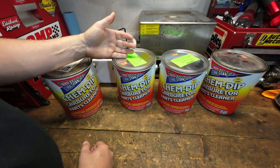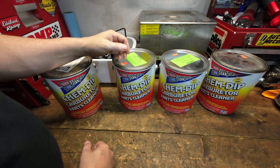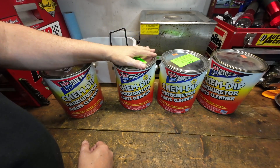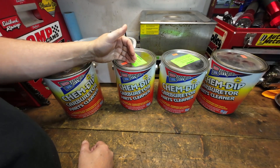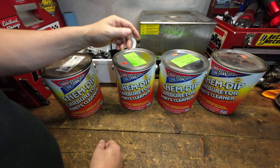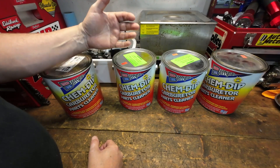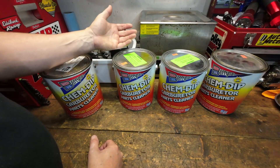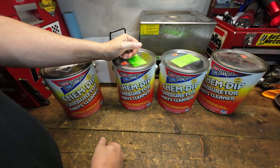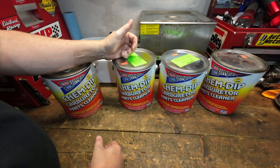The other formula, which is water and amine-based, you'll see it on the container itself. Those can be used in an ultrasonic cleaner because they're made to handle the heat, and they don't have that chemical reaction or solvent with a lot of fumes that can evaporate very quickly and cause a very negative situation, especially if you're in an enclosed environment like a garage or shop. So it's very critical that you get the right type of solution.